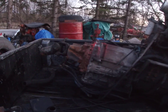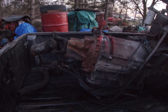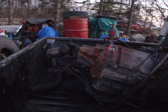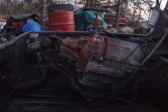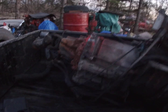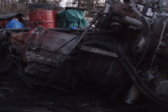The reason for that is the PTO that goes on the transmission is usually rated 200 horse, 150 horse, whatever, or a certain torque rating through them. If you run the PTO through the drive shaft, you can give her, like I guess Derek would say, the onions. She's full powered engine. You ain't gonna hurt nothing there. So that's why I'm gonna leave that feature on there where I can lock it in the drive and lock the converter up, because that gives me the opportunity to always use this for a power supply. If I ever will or not, who knows, but that's where we're at.